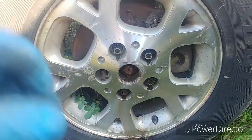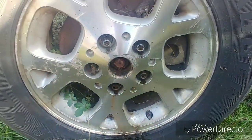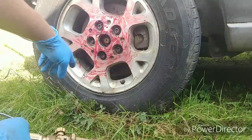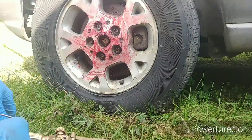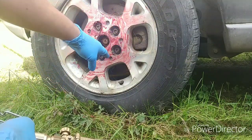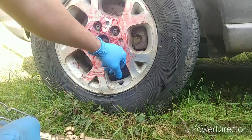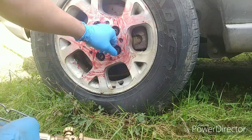The first thing we're going to do is slather this whole area we're working on with grease — anywhere the heat could possibly touch. The only part you're not going to put it on is the lug nut itself. You can see I've applied a pretty healthy dose of high-temperature wheel bearing grease all over the front of the wheel. Anywhere the flames are going to splash out, you want to cover. If you get some on the lug nut it's okay, it'll burn off.